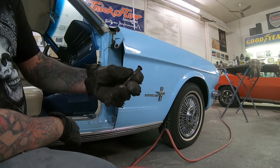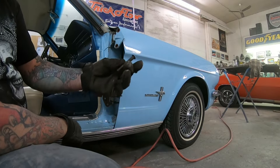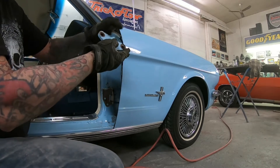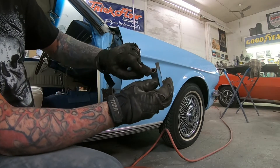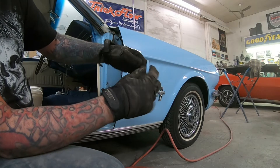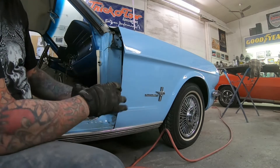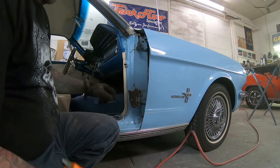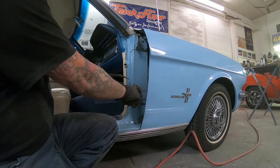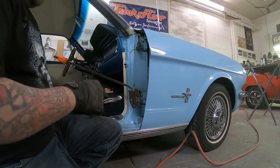So there's our top pin out. You can see they're pretty simple — they've got kind of a knurl on the top. If you haven't done these, that's usually where they stick and then they come out easy. In this case it kind of fought all the way through. You can see in there there's brass bushings in the hinge. That's what typically wears out — the bushing more than the pin — but you'll get a kit for these that comes with pins and bushings. Now moving on to the lower hinge, the first thing you need to do is get that spring out. These things will fly across the room and you'll never see them again — they are a bugger to put back in. There is a tool for them, but the tool really doesn't work too well.